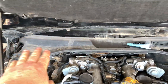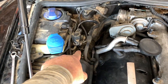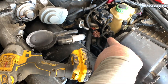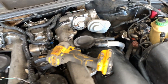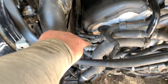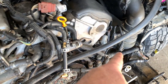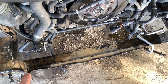I put the panel up there temporarily just so I don't drop stuff down there. Over here I hooked up the O2 sensors, vacuum lines, and the power steering hose to the reservoir. The two starter wires, main power wire, and ground wire are across - got those hooked up. Then I hooked up the coolant line, put the airbox snorkels down to the turbo inlets, connected the mass airflow sensor - same thing on both sides. Connected the AC compressor connection. Now I'm going to put this cross piece on - there are two bolts on each end, number 13.